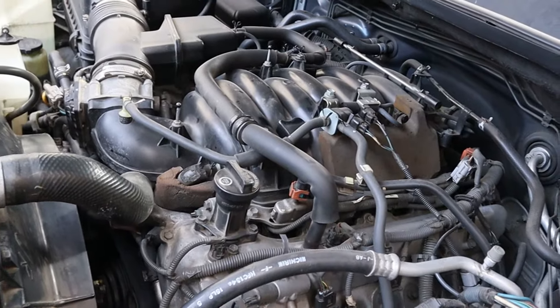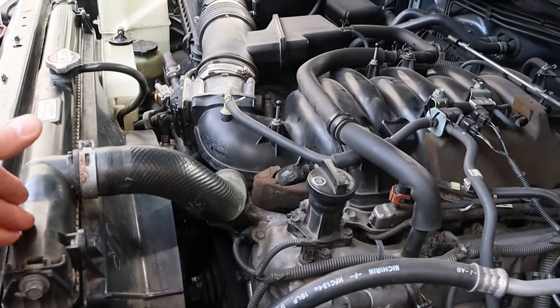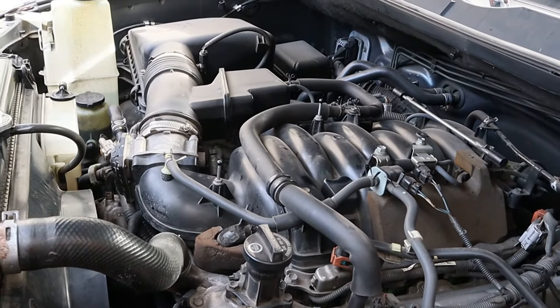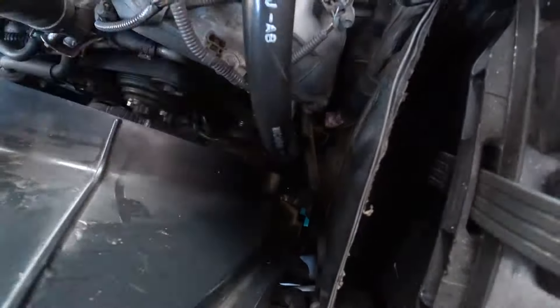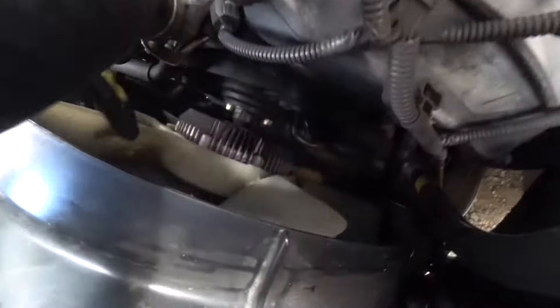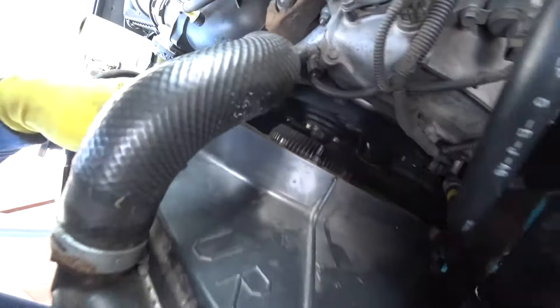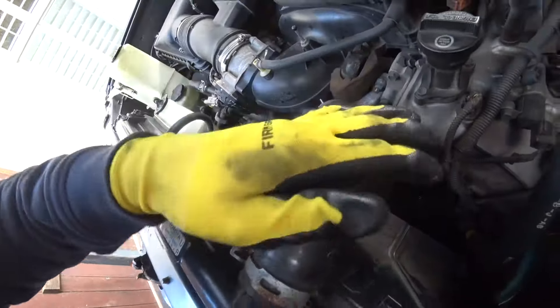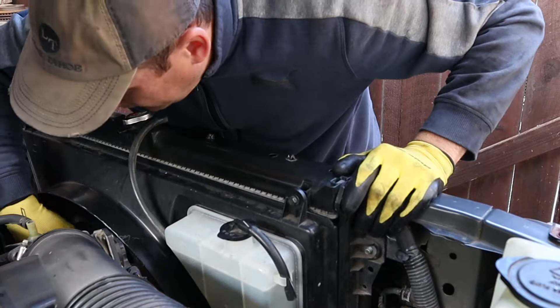Let's start. First I'm going to take out the radiator because I have more access from the front side to the engine. We drain the coolant from the drain plug, located at the bottom. After draining, we take the fan — unscrew four nuts which hold the fan — and then take the fan shroud. Disconnect the upper and lower hoses and remove the mount bolts from each corner, then take the radiator up.